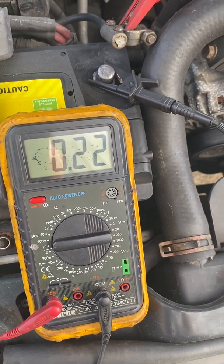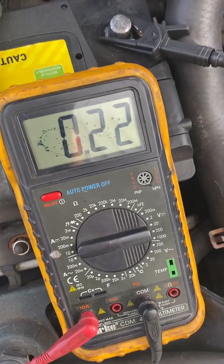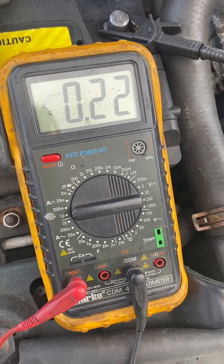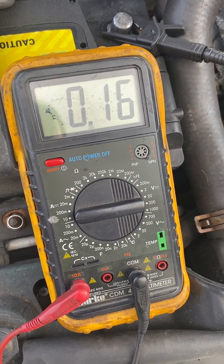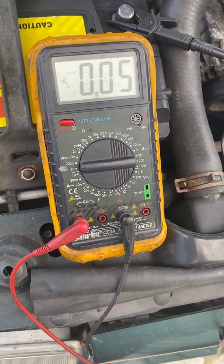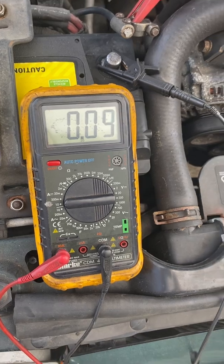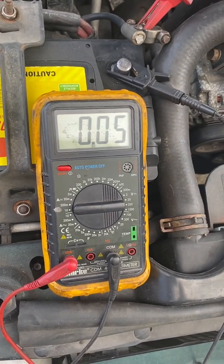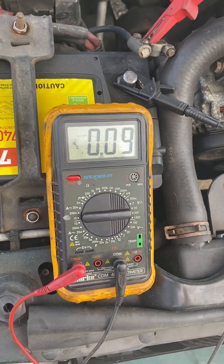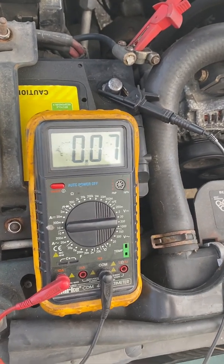So that's pretty high. When we first did our test, it was on 0.02. I dare say that before very long, it'll switch back down to 0.02. There you go — it's almost like it heard me. So there are timed circuits on cars. You have to be aware of that when you're doing your test. Just give it time for everything to settle down and go into its normal sleep mode. That's the mode where it's going to be left for some time. You want to make sure it's not draining too much.